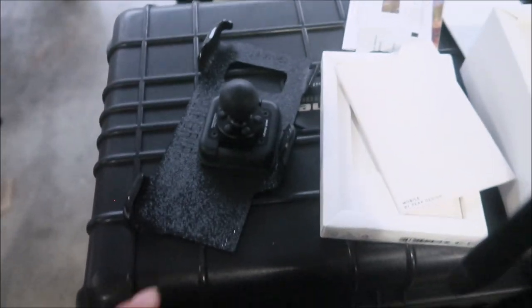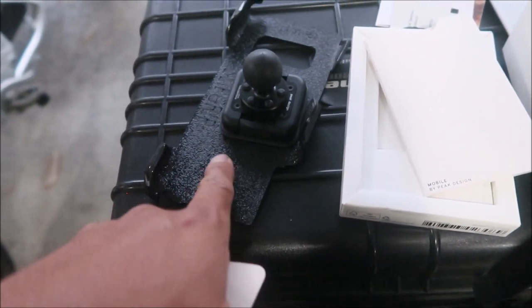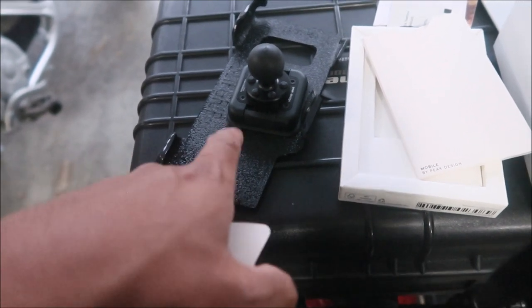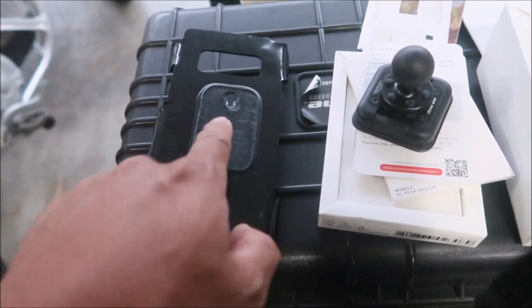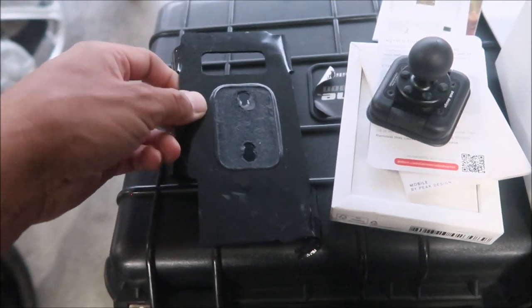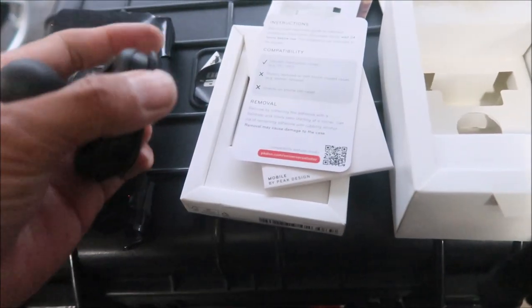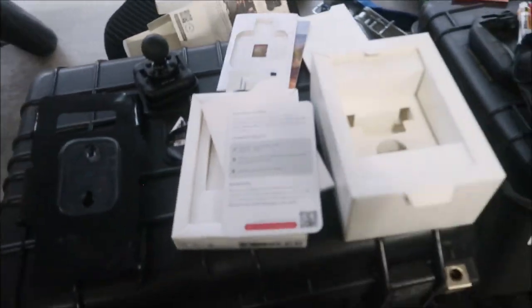Right now this is kind of bumpy — it's got a wrinkle finish on it, so it probably won't adhere very well to that part. We've got to make it as smooth as possible because you can see it's kind of porous. To remove the adapter, you soften the adhesive with a hairdryer and slowly peel starting at the corner. But once you remove it, that's it — you can't use it again unless you replace the adhesive.